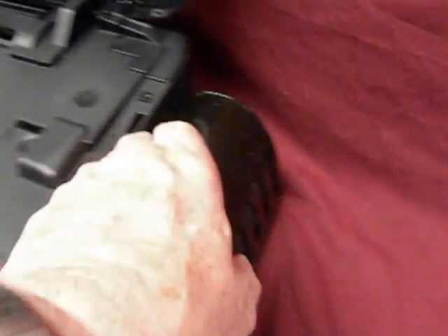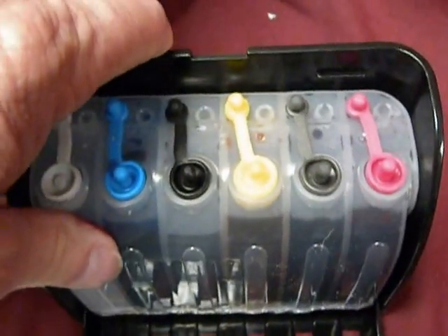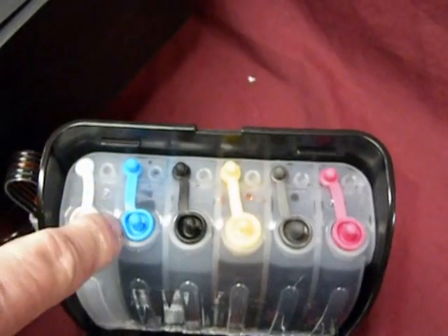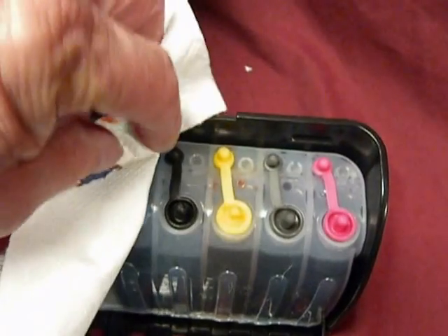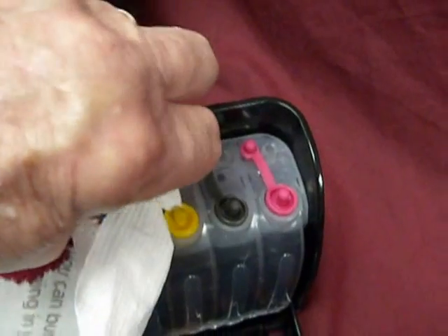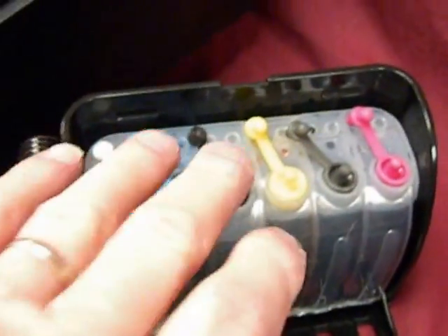Push it all the way over to the right. Now go to the ink tank and open up the little air plugs. We have balanced the isobaric chamber and we're going to open up the plugs in the back. The only time you open up the front plugs is when you're going to refill the bottles. So you close the little one and open the big one — they can't be opened at the same time, otherwise all the ink will leak into the isobaric chamber. Use a paper towel to grab and open it up, because in shipping sometimes a little pressure builds up and you might get ink on your fingers. They have to be open for the system to work.